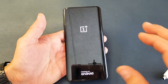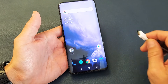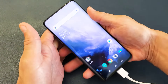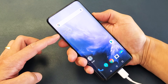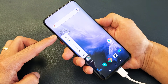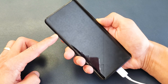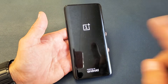If your screen is still black after that method, the next thing I want you to do is plug your phone in and let it charge for about ten minutes. After ten minutes, come back and do the same force restart: volume up and power button. Leave the cable plugged in, continue holding both buttons, and wait for that OnePlus logo to appear. There it is — let go, and hopefully you are out of the black screen.